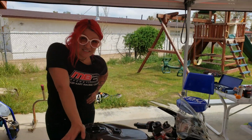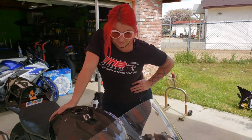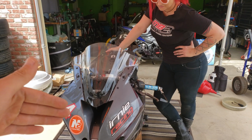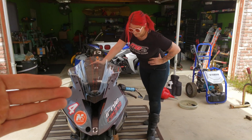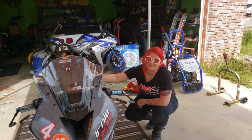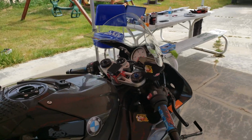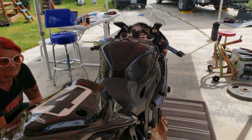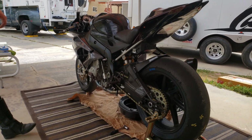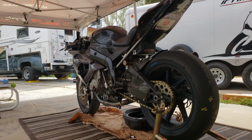So my first step is at 300K, I have around 4, maybe 5% fuel dilution. And if you know a little bit about oil, the bike is running a 10W-40. But once you have 5% fuel dilution, that 10W-40 is getting very close to a 10W-30 viscosity. The second number, guys, the 40 or the 30 weight, is measured at 100 Celsius, which is the operating temperature of your bike's oil. And so we will get the 17 out on the magnetic and drain her out.